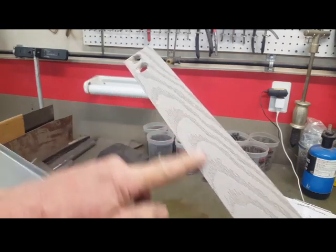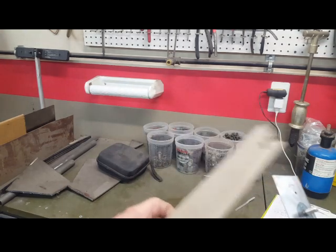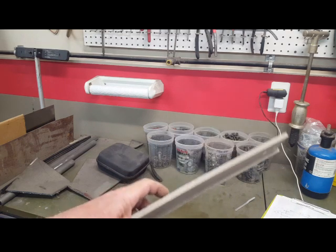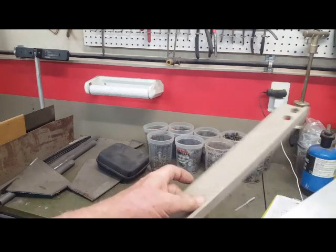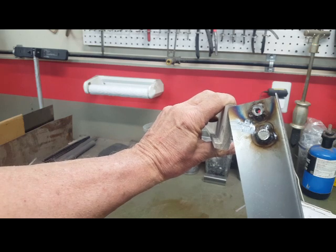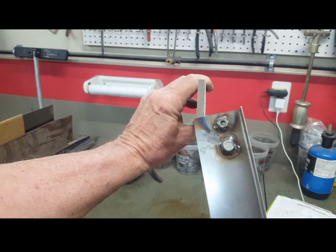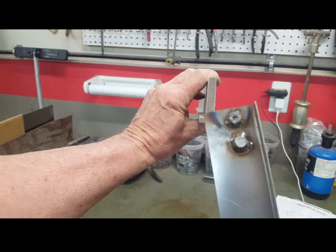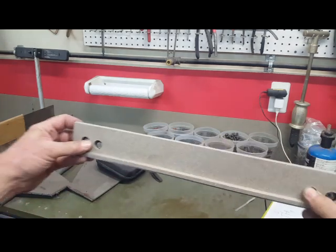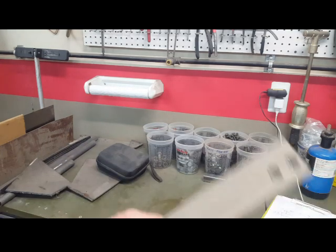This is plastic decking material you get at the home center. It mills pretty cleanly and it's soft but also waterproof — a perfect application. It's about five-sixteenths here plus a sixteenth, so three-eighths total, which is the size of spacer I need. It has a quarter-inch ledge for the glass to sit on and a couple of clearance holes to go around the nuts and studs I already have, which stands the glass off those so it doesn't get harmed by hitting metal when we tighten everything down.